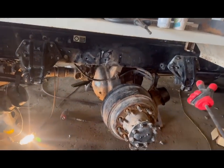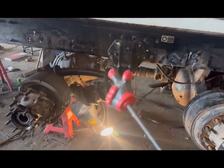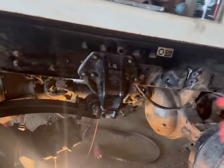The standard width of a normal truck is 52 inches, so you've got to move this one back two inches. Whenever you put this spring in, you will notice that the housing is going to tilt forward quite a bit — this is going to change your angle, so once you're on the ground, you have to check all your driveline angles.